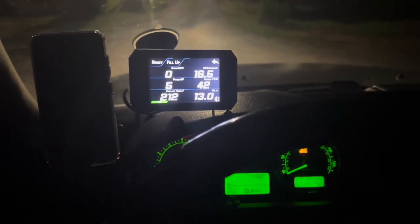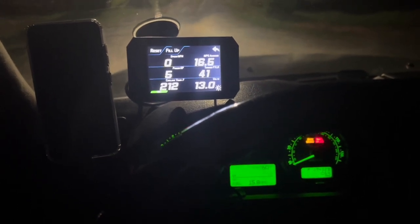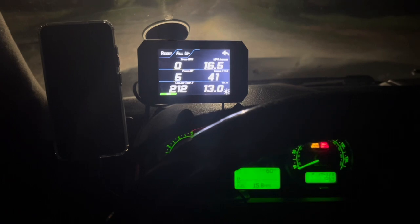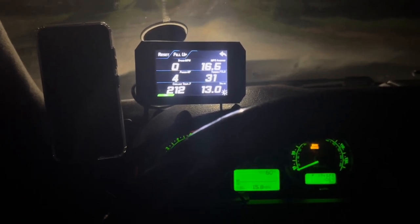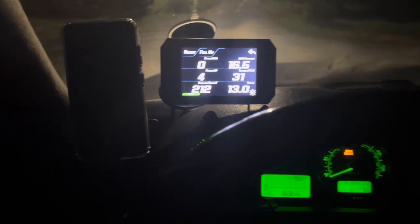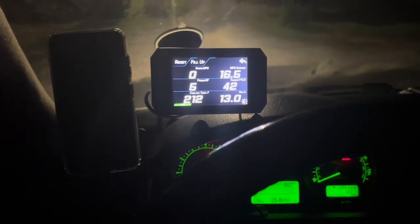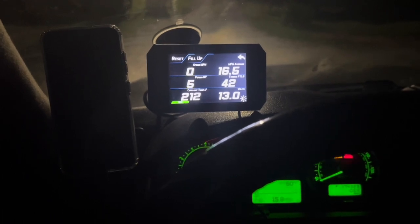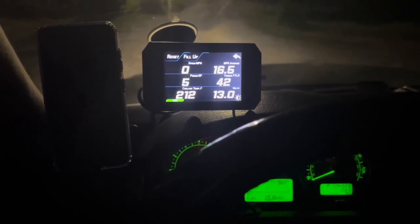At this point it's not really dropping, but at the same time, it's 212 Fahrenheit. That's actually pretty good. It's really good, and I've seen it higher today. I'm wondering, interesting. Maybe the temperature being so cold outside is helping the car cool, because earlier today, the highest I've seen it parked and not moving with AC on 2 was 221. Okay, so I'm just going to turn that off and turn AC on 1 now. But I'm surprised, it's unchanged. It seems like it's not running any hotter than usual. It's like nothing is impacting it, and it being at a constant 212, that's pretty nice.